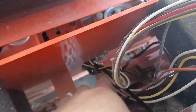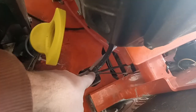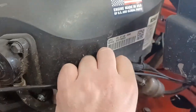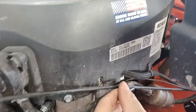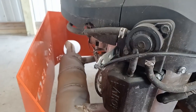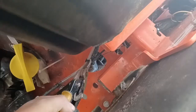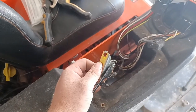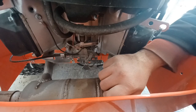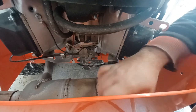The next step is to come down here with a pair of side cutters and snip this zip tie. Come back here — this one needs to go. This here just kind of pops down and out so you can get it out from underneath there, then snip this zip tie as well. Now all of this is loose. Next, take a T20 to this screw and loosen it up.